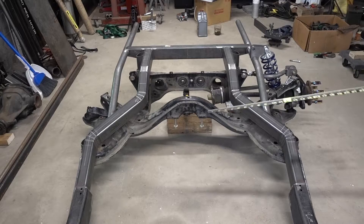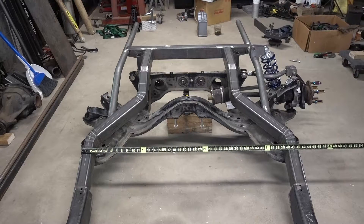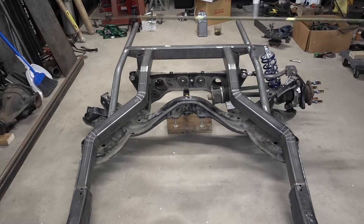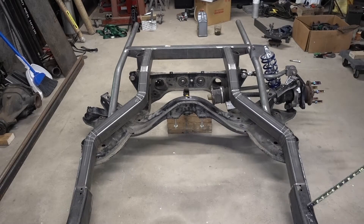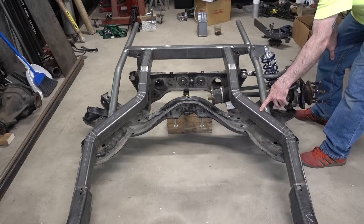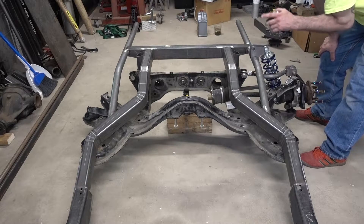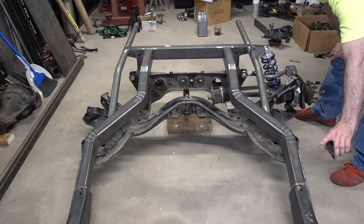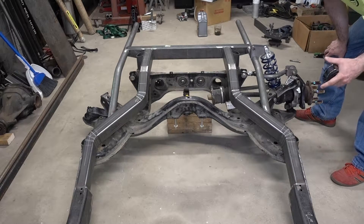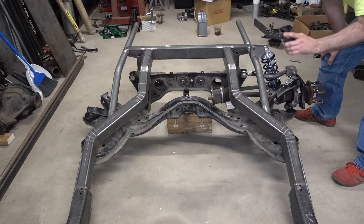First thing — it's not really a big deal, but I went with outside dimensions on the stock frame because that's where my rails were. That's just a hair under 42 inches, like 41 and 15 sixteenths. That's really just outside of stock frame rail to outside of stock frame rail. These rails are brought in on a 45 degree angle on both sides — they turn in at 45 and straighten back out at 45 to come out the back. You have a flat on your stock frame rail when it comes to the back and it comes up. This angle here is 24 degrees.